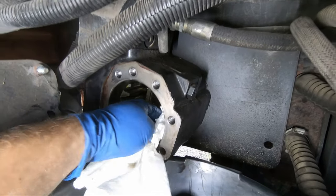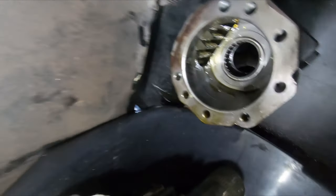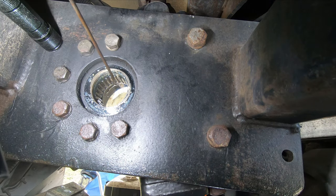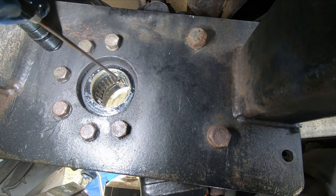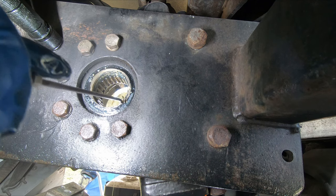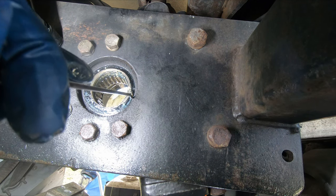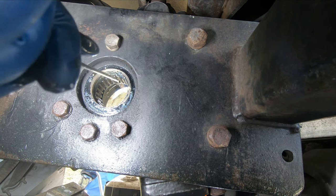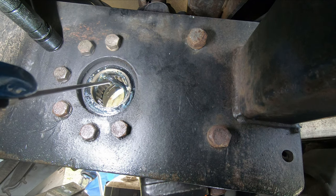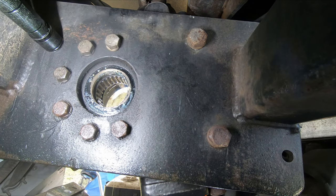No goop. Removes the goop. So I can't quite sit up inside the generator bay here, so I have to kind of reach up. I'm not blind, I can see pretty well, but I am blind on the bottom part. You can see all the blue, that's like that seal disintegrated. On the other one it was more chunky, this one it's more of a paste. Yeah, I think the blue part of the seal is entirely disintegrated.